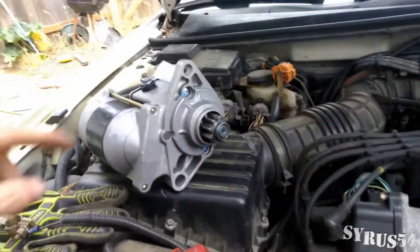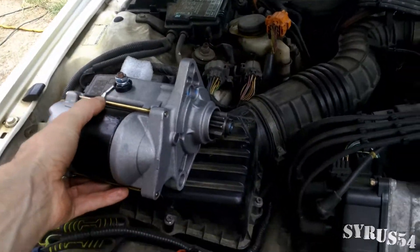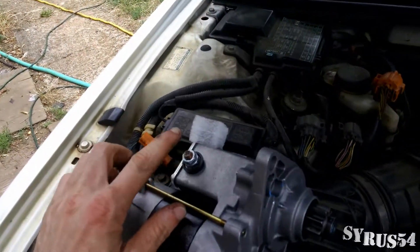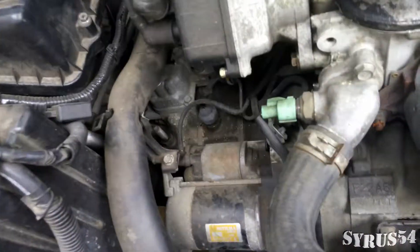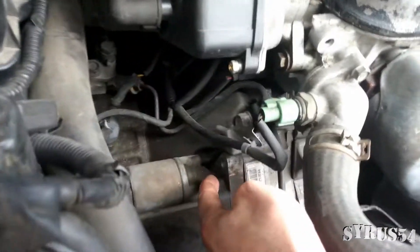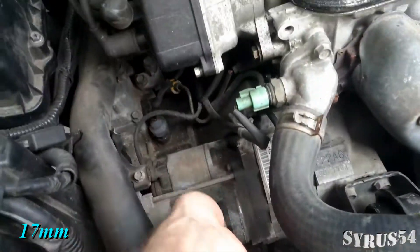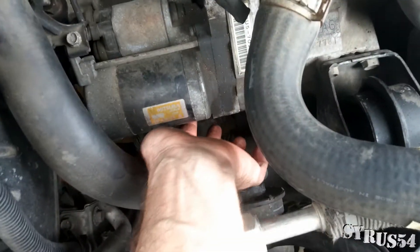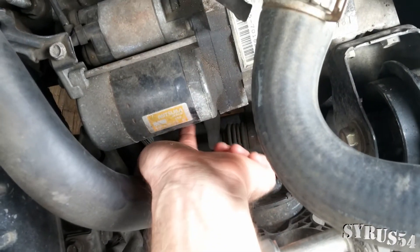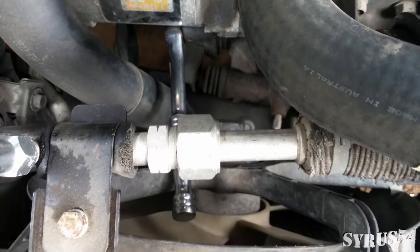Now one thing you might notice is that you have a smaller hole and a bigger hole, which means that this starter is going to sit in there just like this, even though there is a power plug on the top and that connector is on the side for the original starter. So right here is my smaller 14mm bolt, and that larger bolt — which is going to take a 17mm — is down here. I don't have enough room to stick a wrench down in there, so I'm going to have to use a socket wrench.